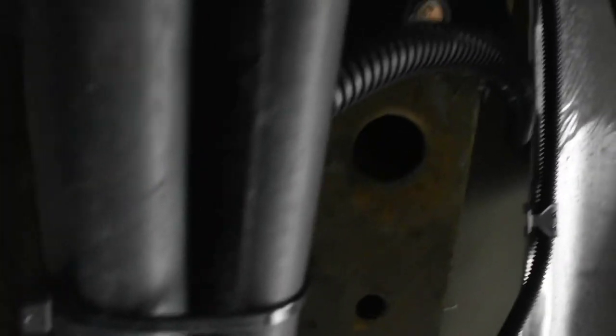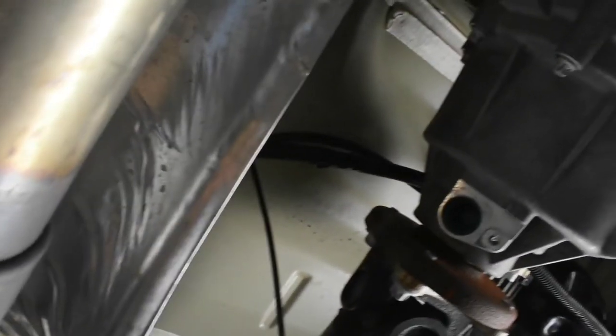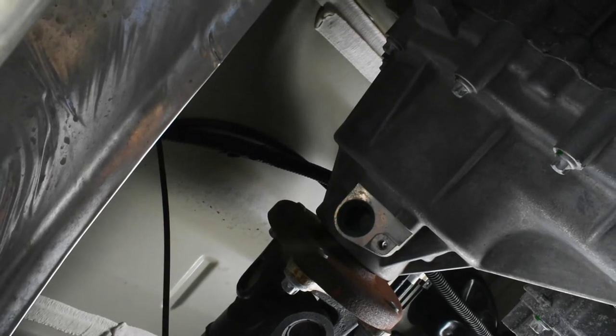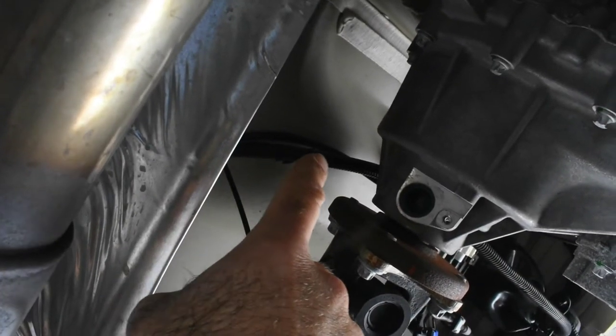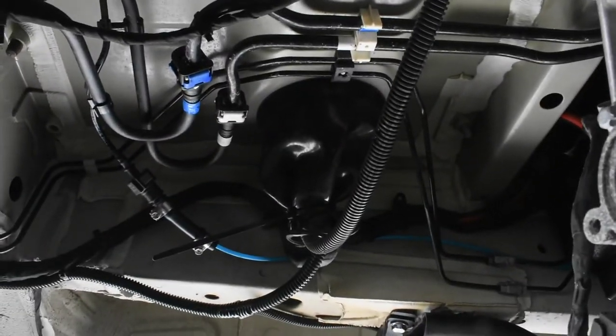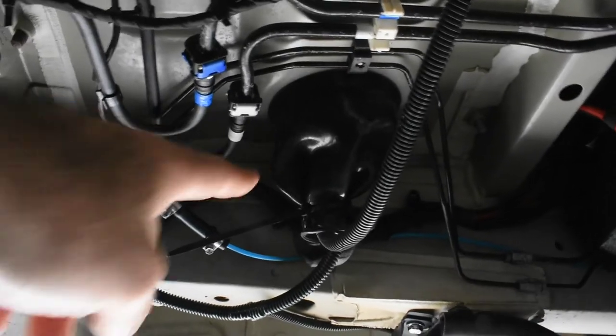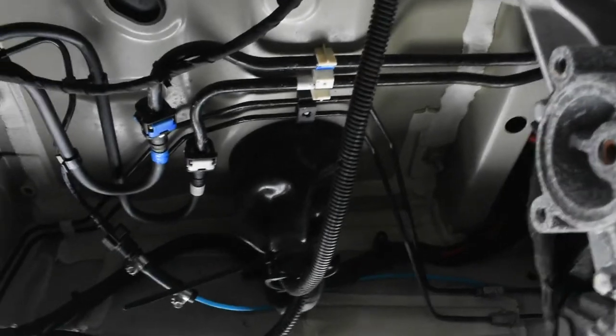This is the path that I used. It comes up here, then it jumps over the exhaust heat shield and over the transfer case. There's a factory cable there that I zip-tied to, which looks like I need one more zip tie on there. And then this is where we come out underneath the driver's seat. After you get everything situated, just put another zip tie on there and cinch it down — it holds everything nice and tidy.